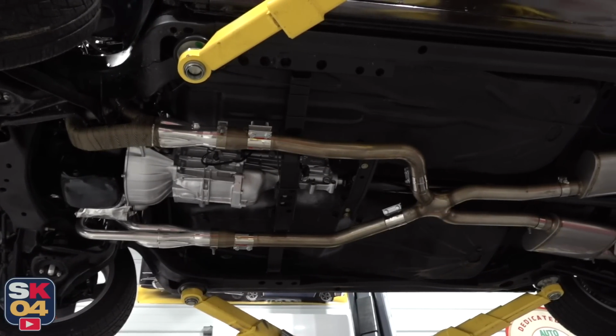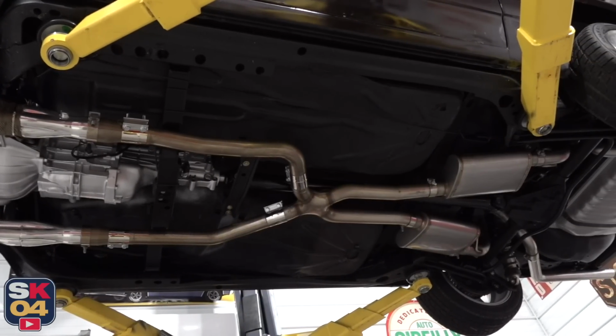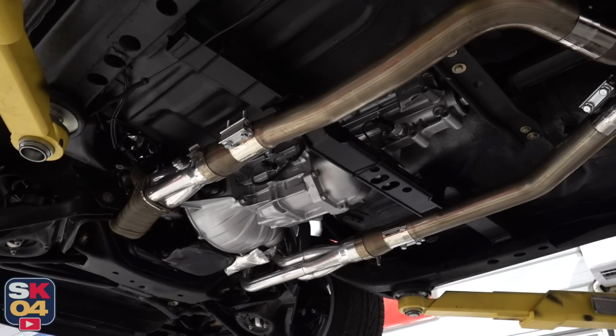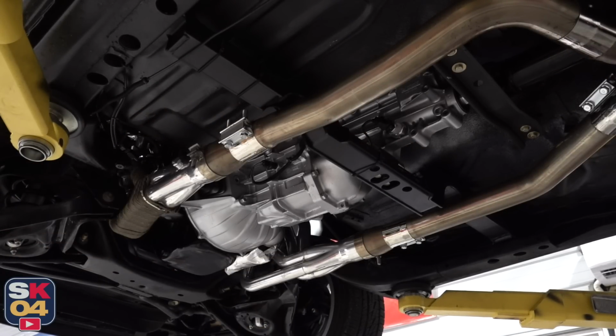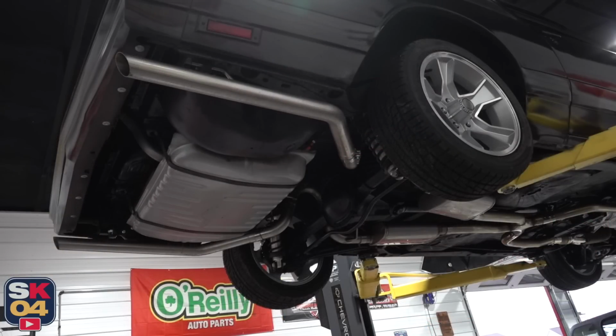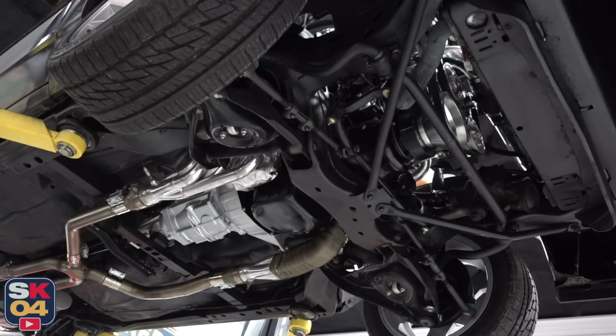I mean, the whole kit has just gone together spectacularly, from the custom bracket that goes on the back of the brake booster where the clutch master bolts, to the clutch pedal assembly, and how it just literally installs into the existing G-body pedal assembly with little modification, cutting down the wide brake pedal. I mean, that's really it. Attach all the hardware, make a little hole in the firewall, start plumbing things up and whatnot. The hardest thing legitimately is just shoehorning the transmission up in there. So this has been awesome, and I can't wait to hit the road.